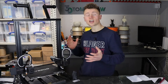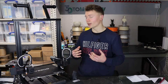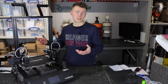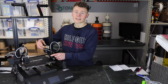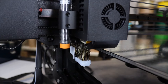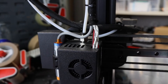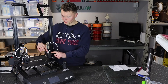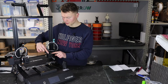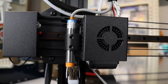Now I'm going to dive in first to the pros of this printer and what I found it did particularly well. The first thing I quite liked on this printer, above the standard design, is the way they have set up their hotend. On the printer you'll see that it runs along these nice linear rails for the X axis, and that provides quite a nice smooth setup. Specifically, the bit I really like is the efficiency in the X direction. You've got your hotend with its heatsink built in around it and a cooling fan to the front, a space which allows for the airflow to escape, and then the front fan which acts as the part cooling fan.